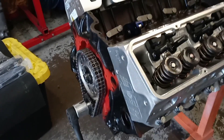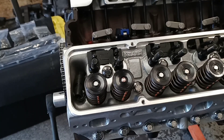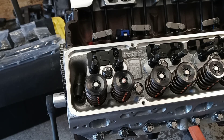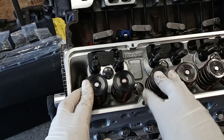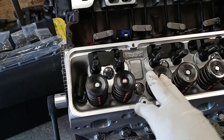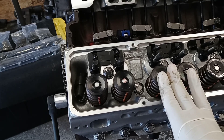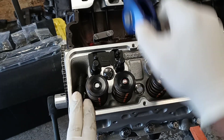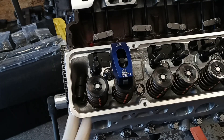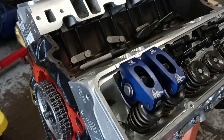That's one of the methods I use — very easy, been working for me for years. When installing or building an engine, a lot of people fail to get the right geometry, and it truly does affect performance. Each engine, depending on the type of lifter and cam combination, will take a different length push rod.